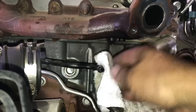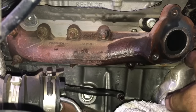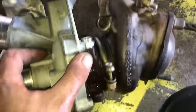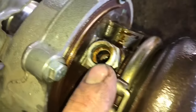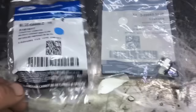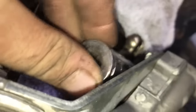Since this is a water line it'll be dripping, so cover the oil lines to prevent water contamination in the oil system. Inspect all your studs — there's a separate video on repairing broken studs and checking for leaks, which is very common on high mileage EcoBoost motors. With the turbocharger off you can see the top fitting and the side fitting that's leaking — pretty ugly. Take it to the bench and replace the fittings. New fittings are ordered directly from Ford; part numbers are in the description. You'll also need a gasket for the oil lines — use a 19mm socket to break the old fittings loose.